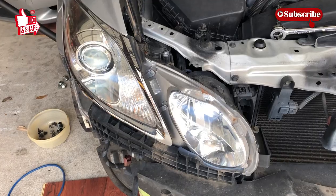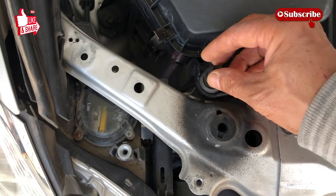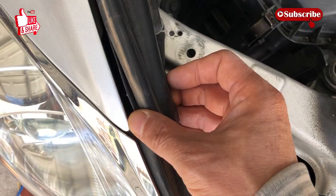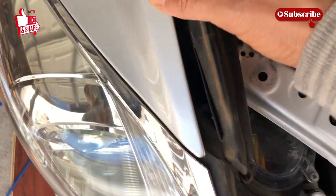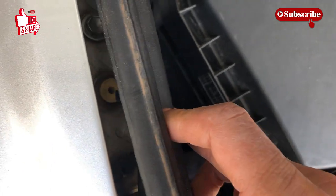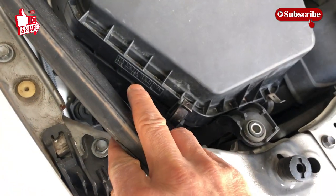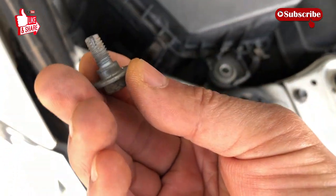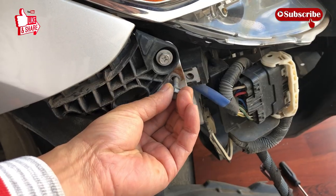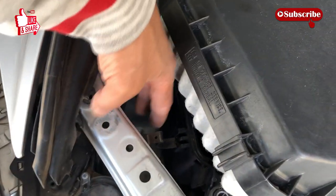I'm going to remove the right front headlight. There are several bolts to remove: one long bolt with a washer, another one you lift up and pull out — it slides underneath a clip so you need to push it out while lifting up. There's one more bolt hiding here, a short one with a little lip. By the way, all of these were 10 millimeter. After taking out the side bolt, I pulled the headlight out a little bit to get some access room.